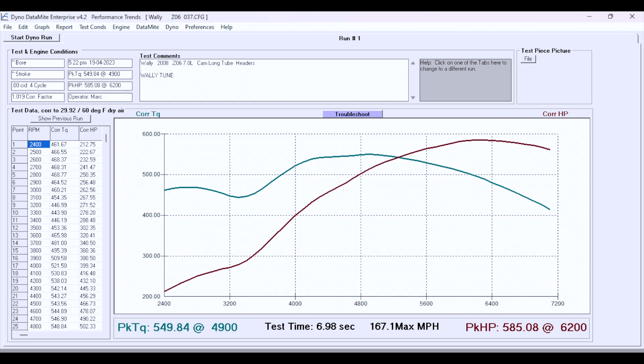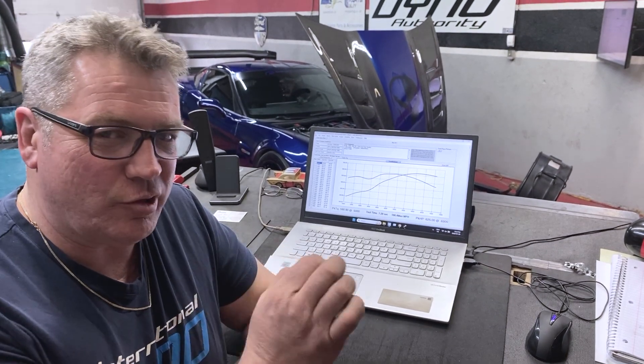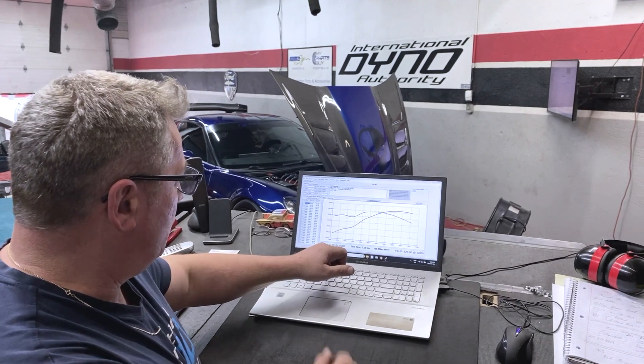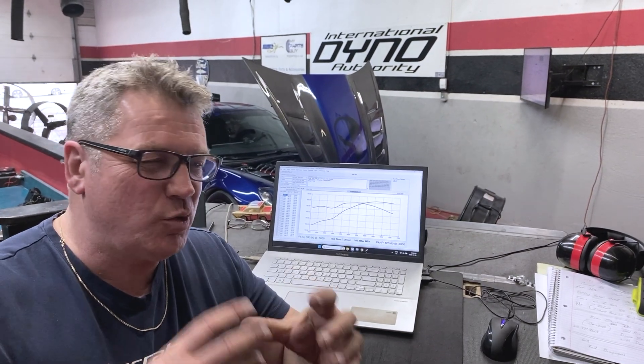On a big motor like this, the numbers are going to raise very quickly — we've got a lot of cubic inches to work with. So you start with a base pass and move up very quickly into a lot more horsepower. We moved up to 549 foot-pounds of torque and 585 horsepower with some basic adjustments, making sure the engine is up to temperature. As soon as we start adding just the right touch of timing and fueling on the upper end, that makes a big change on a big motor. We run up to 590 foot-pounds and 625 horsepower — that's our midway point. You want everything to work its best, but you don't want to be on the bitter edge.